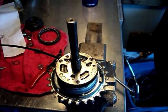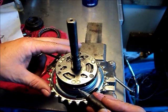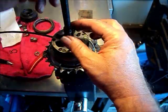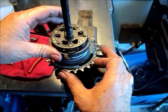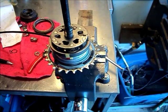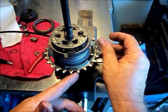Now we'll shift this thing to a gear that engages the sun gear to the axle — we'll go for fourth gear. Now the sun gear is affixed to the axle. When we turn the input, the planetary gears rotate about the sun gear, and when they're meshed with the ring gear on the second stage they will actually overdrive the second stage at a higher ratio. With the sun gear disengaged the second stage and first stage rotate at the same speed. Now shifted to engage the sun gear, you'll see the second stage being overdriven by the first stage — you can hear the pawls ratcheting on the ring gear as the ring gear outruns the first stage.